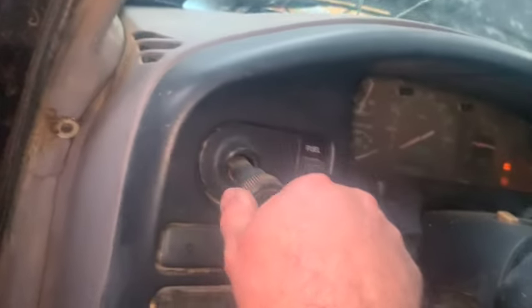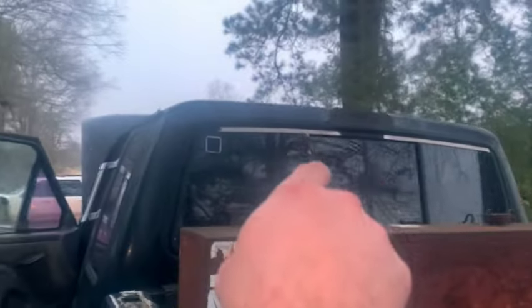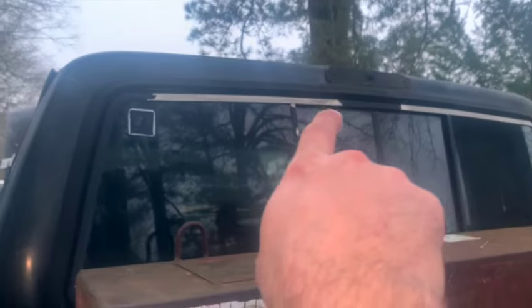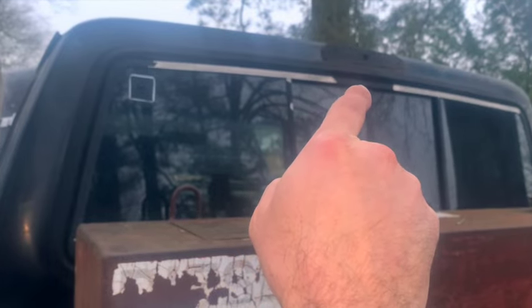But everything seems to be working. I know we have a lot of wiring damage, but I kind of need to inspect and see what I'm looking for. I need to get a rear light here. I busted my tail end. Got to get a top brake light because that can affect lockup on the transmissions in these trucks. That might be a lot of the problem.